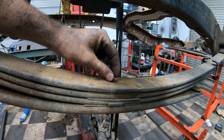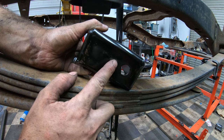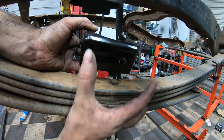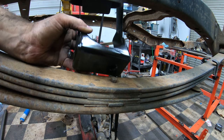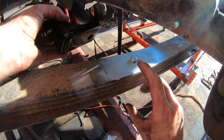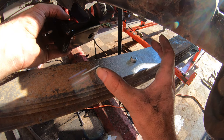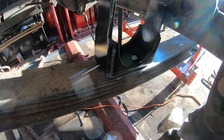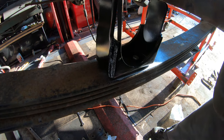Now that the bolt is flipped on top of your leaf, these here are the supplied flip kit plates. You'll notice the hole is not centered like the original one that's welded to your rear axle — that's because your rear axle is now going on top, so it needs to be moved over to stay centered. That hole needs to go towards the front so that your axle can still be centered. The plate is slightly offset so where the rear end used to sit below, it'll now be up on top and moved back further.